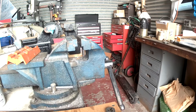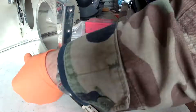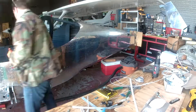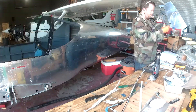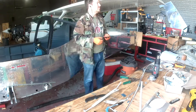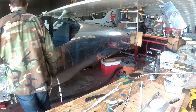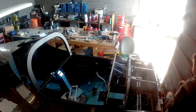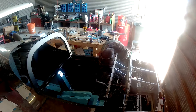They're AN4-7 bolts. In your RV-14 kit, Van's sends you four AN4-7 bolts for your finishing kit, but two of them are special — they have an extra quarter inch of threading on them. Not shockingly, I used those bolts somewhere else, and they are in a place where they cannot come out. They're actually holding down the roll bar bottom fittings. Knowing I can never get those out again — and thankfully they are torqued properly — I just went ahead and got a tap and tapped the other two that I had. If you accidentally do that too, what you need is a one-quarter by 28 tap.